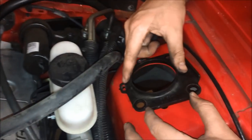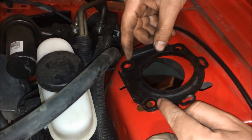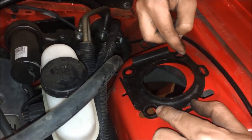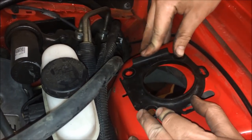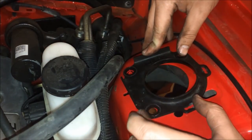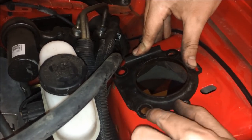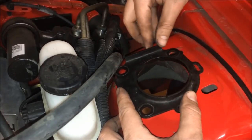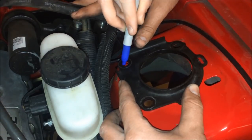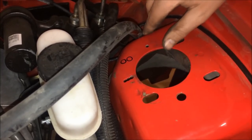Take your factory bracket, rotate it 180 degrees, and line up your holes on the factory slots — first on the inner side, then line up the other hole on the inner side as well. Take a sharpie and draw a circle on that outside edge. Now shift it downward toward the other end of the oval slot — that's the factory circle — so now you're on the outer edge on both holes. Draw another circle there. Right between those two circles is where we're going to punch and drill our next hole.